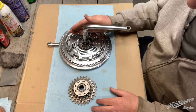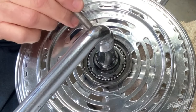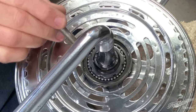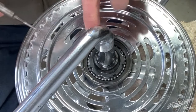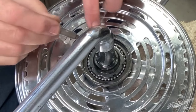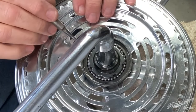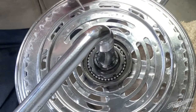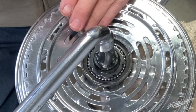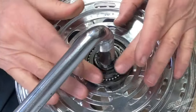Anyway, let's get started on the front part and I'll show you how to take it apart and how it all looks underneath. The first thing you want to do is this top piece with these four indents — it's actually the base piece that is screwed onto the crank. The bottom part of it is the race for the other set of ball bearings on the other side. To start taking it off, you need to get this lock ring off of here, and the easiest way I found to do that is with a punch.